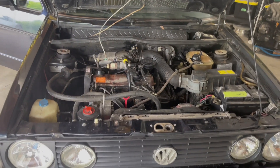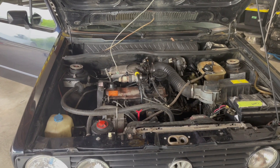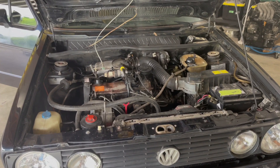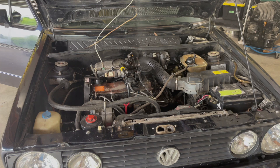Okay, to get you guys up to speed — checked all the fluids, new fuel, I needed to add a little bit of oil, added some coolant, hopefully that isn't a waste. Primed the fuel system a whole bunch, got some clean fuel coming out. I also manually made sure that the crank rotated, so we're all good there — no real issue with that. I think we are ready for a key start. So let's give it a shot.